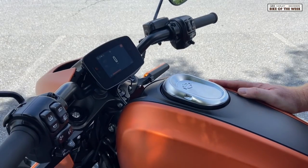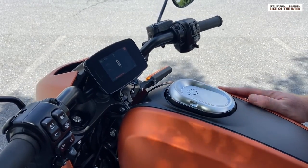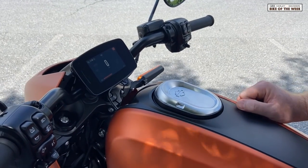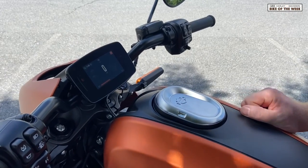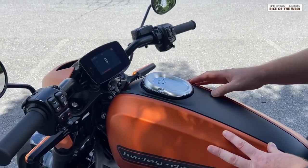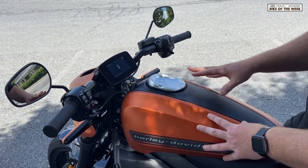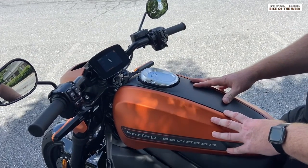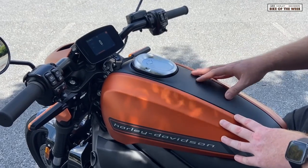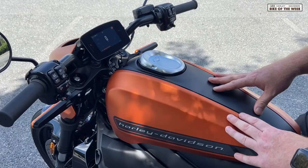Now that has two effects. It makes your motorcycle's battery life last longer, but more importantly for these demo rides, it means that when you roll off, it's gonna feel like the motorcycle is braking for you a little bit. So brakes are way less necessary than they have been in the past on this motorcycle. It's a super easy experience, and I guarantee you that once you start riding the motorcycle, it's gonna feel really, really intuitive. But I wanted to let you know that that's something that's gonna happen when you go do this.